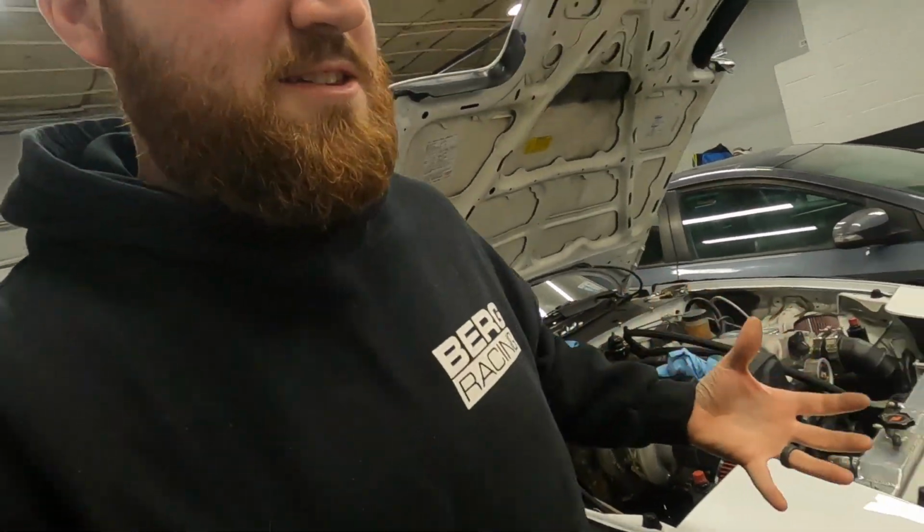And it's not like I had to pull it into position. There's some play in the whole assembly, so I just lifted it up a little bit. But it could go farther up, it can go down, it can go left, and it can go right. So really, it's very central to where it needs to be, which is sweet, because that means under load, as the motor's tipping and tilting, it's not going to put stress on other parts of the system.